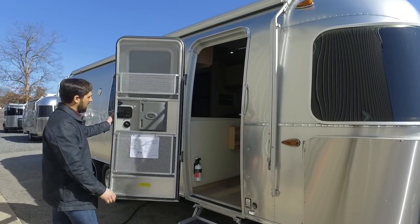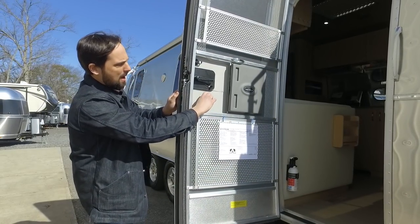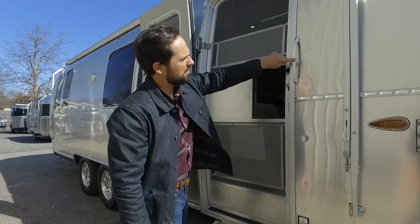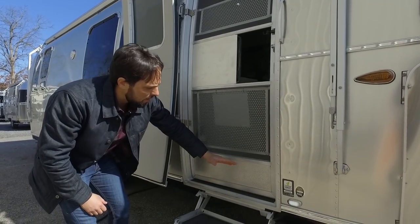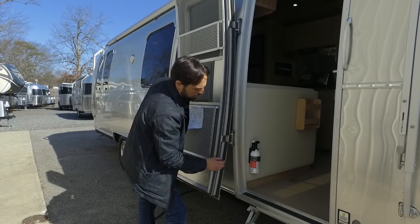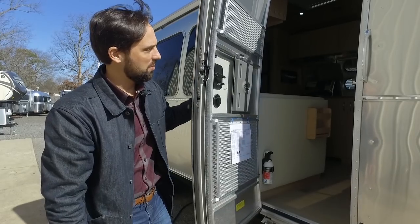You've got to love this door on the Airstreams — it takes about eight hours for one person to build. All the pieces on the screen door are TIG welded aluminum, with screen door guards, a heavy-duty deadbolt lock, and heavy-duty entry door handles. When you swing the door around, it clips in and this piece fills the gap. It's an aluminum grab handle, all extruded aluminum structure, TIG welded at the bottom, with grip tape so you don't slip on the way out. The door is on an angle so water runs right out. There are stainless steel hinges for the screen door, a thick heavy gasket for the entry door, and a 45-degree angle plate so you can sweep the trailer out easily. The bank-vault sound of an Airstream travel trailer closing is iconic. There's a riveted entry door window, an extruded aluminum gutter rail over the door to prevent sheeting rain from running down the entry, and heavy-duty cast aluminum hinges.